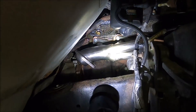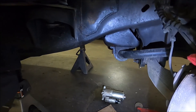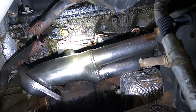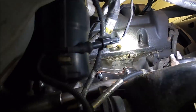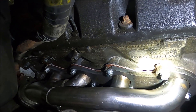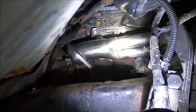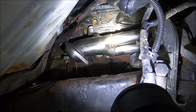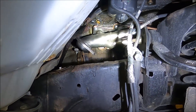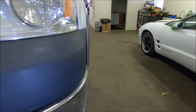After a lengthy period of time getting this header bolted up — and it was a lengthy period of time, not gonna lie — the starter does have to come out. The starter is right there; it has to come out to make it easier to get to these bottom bolts back here at the mating flange. Other than that, the rest really aren't that bad to get to. The passenger side header is completely done.